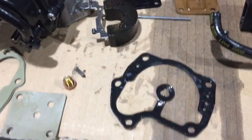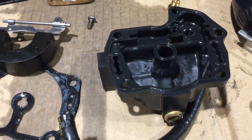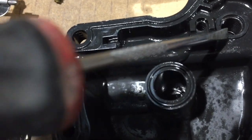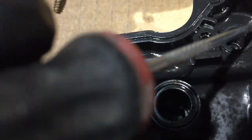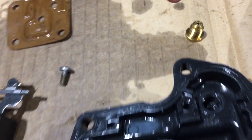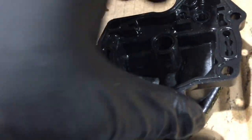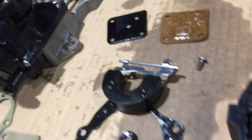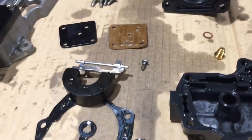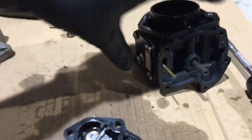I did some reading on this because I'm not used to these plastic float bodies. This lip here is actually supposed to be there — I thought there was a gasket stuck to it. With these plastic float bodies, you do not need to use sealant on your needle or seat before putting it in. Pretty much what you do is put it in and adjust it upside down so the float level is about even. Check that before you're done — if not, you might have some issues running and have to pull the carb back off to readjust.